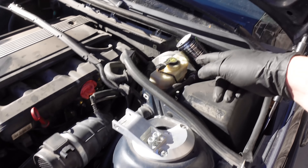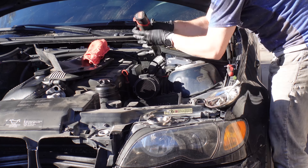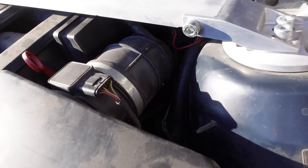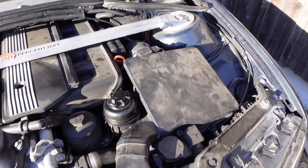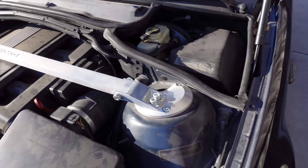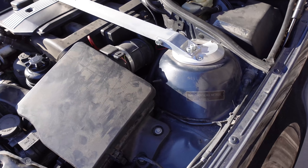I'm going to throw the DISA back in and wrangle that big plastic thing back in place. There it is, all done. No parts left over, nothing unhooked that I'm aware of. Let's go drive it. The only thing I forgot to do was get a new cabin air filter. I did remember to hook the brake booster line back up — that's important. Now it's time for the real test to see if this idles better and see if my fuel trims are any better. I haven't smoke tested this — I can't really smoke test it with how windy it is today, but here's hoping.